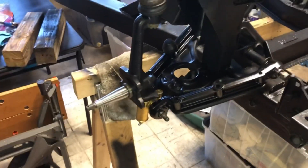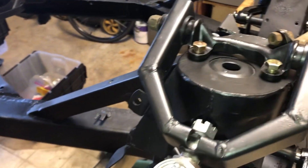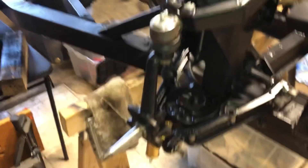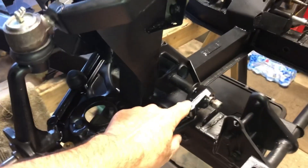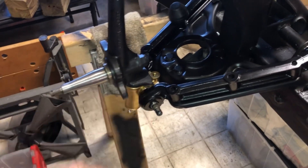I've got most everything ready to go on the front end. I'm going to take a few of these bolts off that I've located. I've got a mix of parts — you could either use the nylocks or the slotted, but I prefer to go back with the original slotted. I'm going to put these in some vapor rust and throw a light coat of paint on them. I got the pan out to figure things out — in the previous video I showed the bolts sitting straight up which was wrong, so I had to flip them. Got the trunnion just sitting in place.